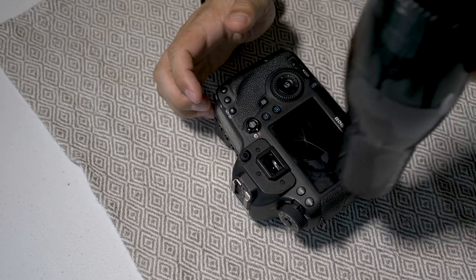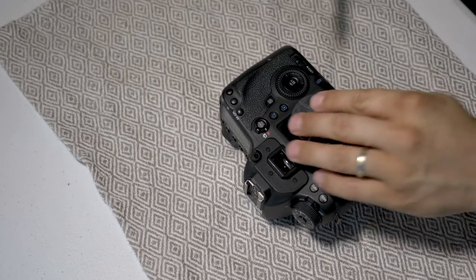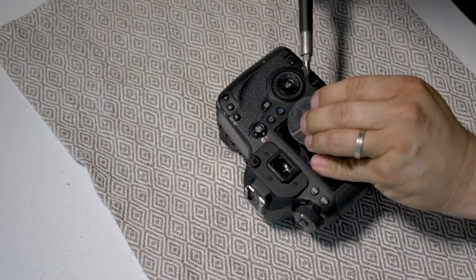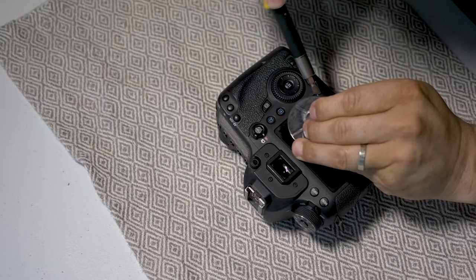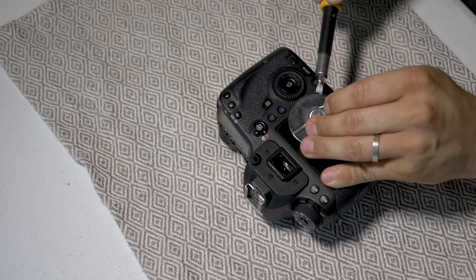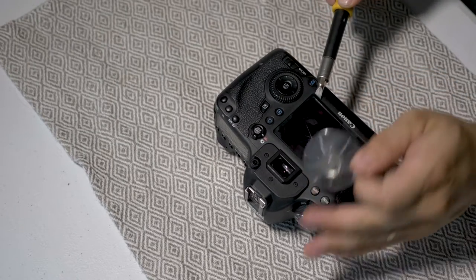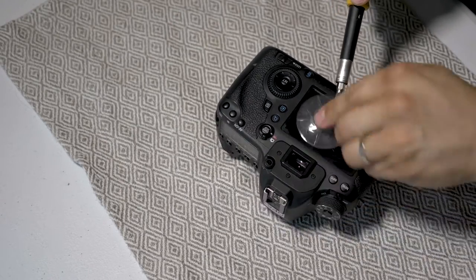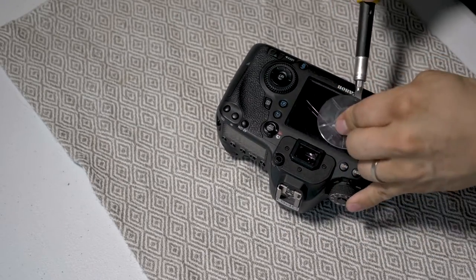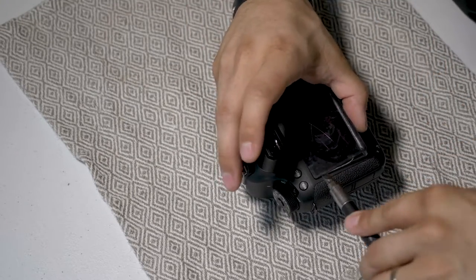You can see here I heated it up with a blow dryer and tried to get it up with a suction cup. It took a little bit more blow drying. What I figured out later is if I can just get one corner up, I could get my flat screwdriver in there and just pull it up. Then I just make my way all the way around — just a thin bead of glue that goes all the way around. You've got to loosen it up enough to get it up.